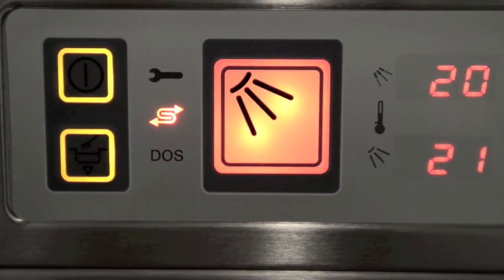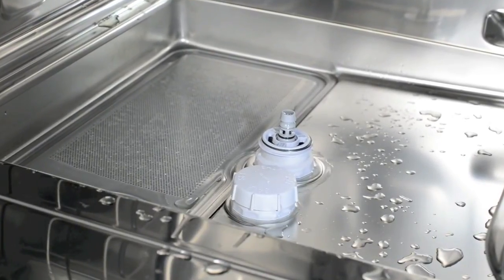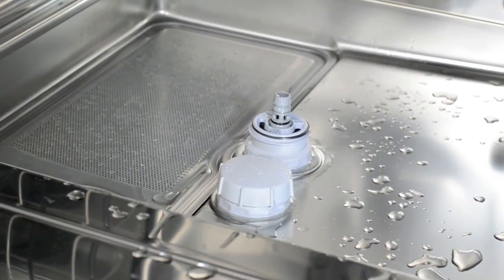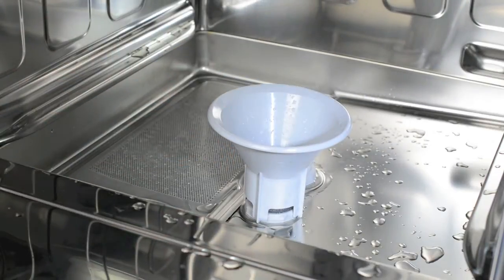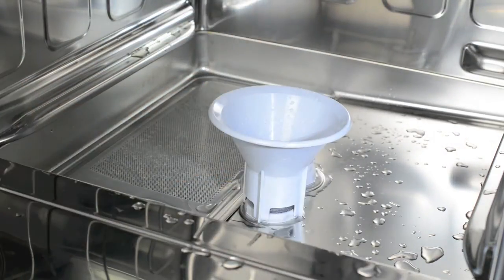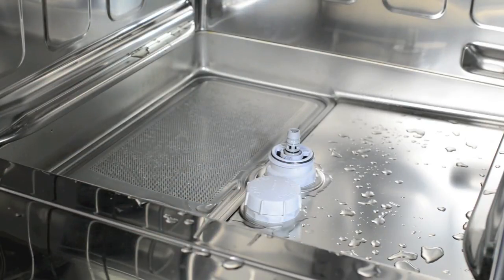Water softening. If you see the S symbol flashing on the control panel, you will need to add granular salt to the machine. Softening the water is important as this prevents the build-up of limescale. If not softened, the machine will go white or cloudy inside, and this will affect the washing results. For the integral water softener to function correctly, the machine must be filled with granular salt — not tablet or table salt. This is really important. To fill the salt, remove the grey cap inside the machine, fit the funnel, and pour in the granular salt until the unit is full. Remove the funnel and wipe away any salt spillage from the machine. Replace the grey cap, close the door, and the whole process is finished.